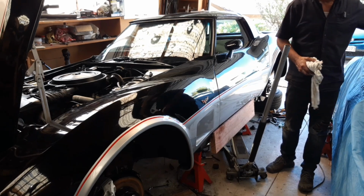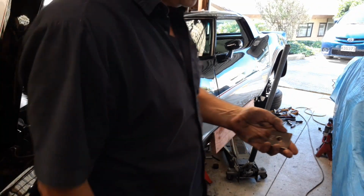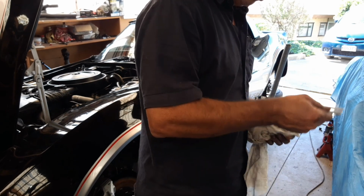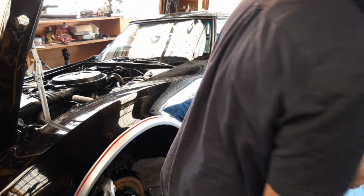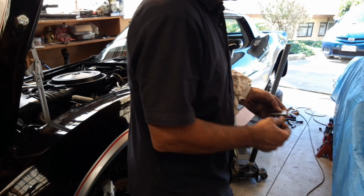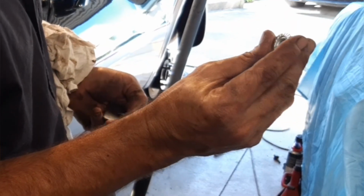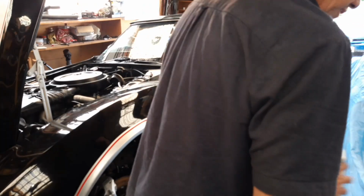In fact, I'll show you what I'm doing there. Went down the road and picked up a couple of these. They are a couple of 50mm or 2-inch stainless steel by 1/8 or 3mm plate, and so they will sit on top inside where that square nut I showed you was, and replace that. So basically twice the size of that square nut, so it will spread the load fine. And then it will get the bolt up from the top, and a nut on top, one of these ones that comes with the kit. It's got the serrated edge on the bottom for gripping. So that'll sit on top of there, and that'll clamp up nicely. So let's get rid of this jack and carry on.